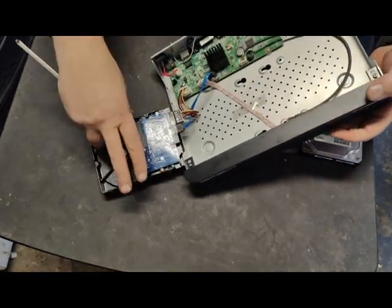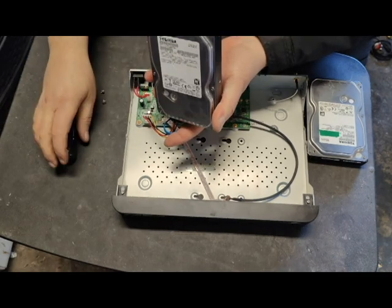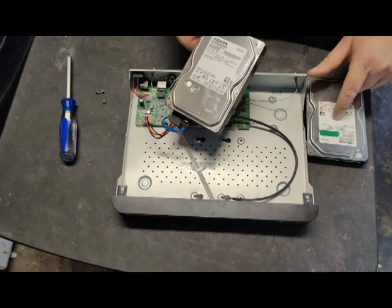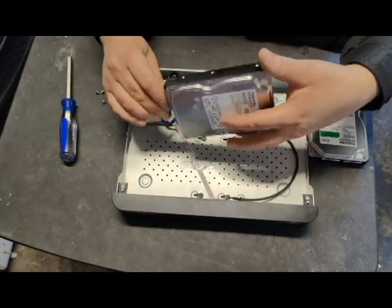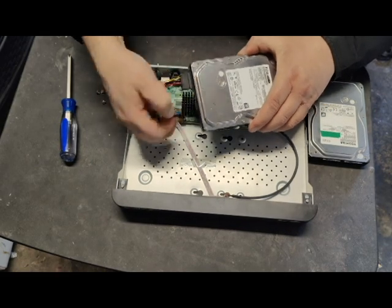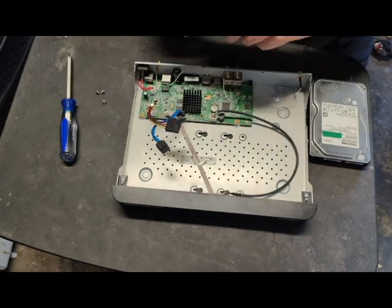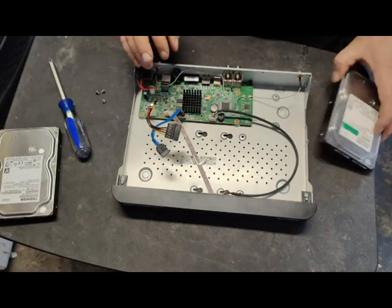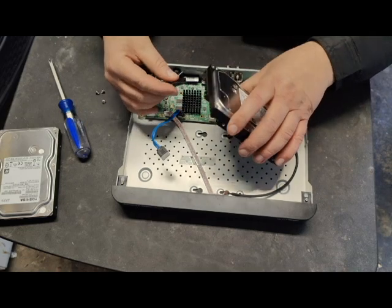Now we're left with two cables. This is a SATA drive, so this is common and very much your standard everyday PC kind of thing — that's why I have an extra one of these. This is your SATA cable; you want to push down on the little silver tab and pull that out. This is power, so just pull it on out. This drive is most likely dead — I'll test it later, but for the most part it seems like it's not wanting to work at all.